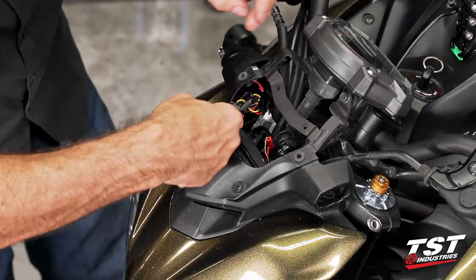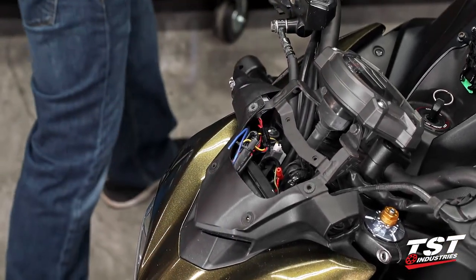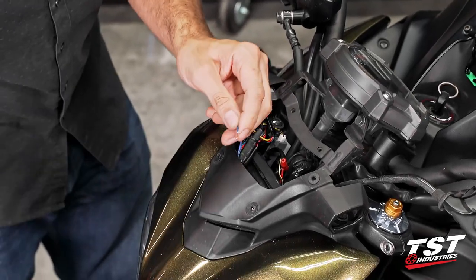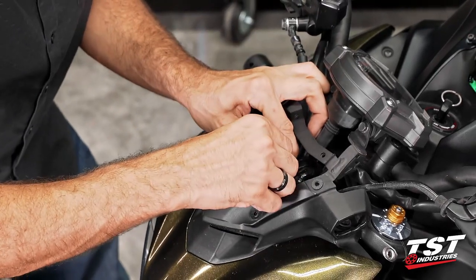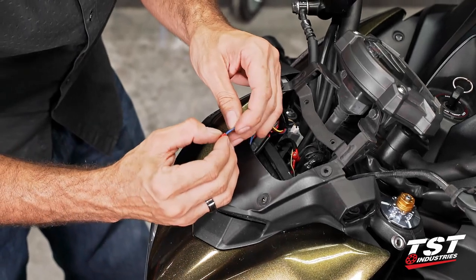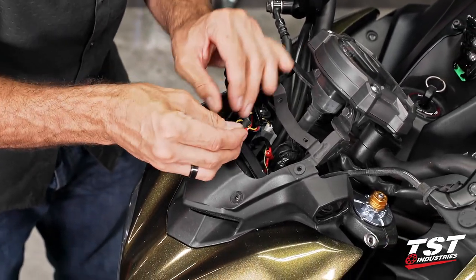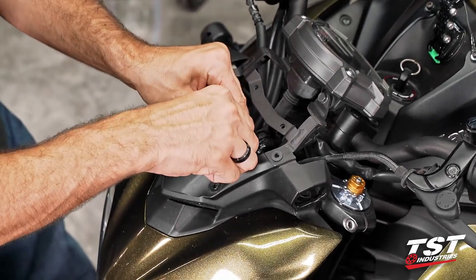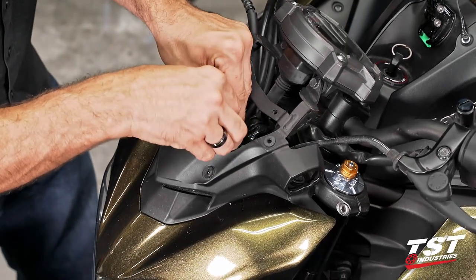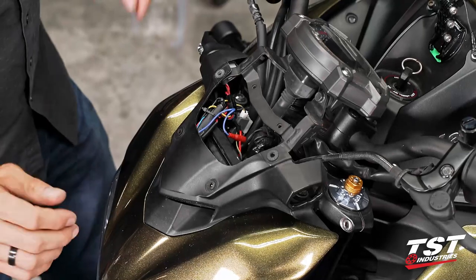With this wire bulk in here, we know approximately how much wire we need — I'm going to snip it off. Strip off about three-eighths of an inch. We need to remove the cap from this connector and insert it over the wire with the non-threaded end, making sure we have about an eighth to three-sixteenths of an inch of exposed wire sticking out. Then we're going to return this to the connector and thread that on. Make sure that no exposed wire is sticking out from this connector, because during vibration and shifting, it may contact the frame element and cause a short or blow a fuse.